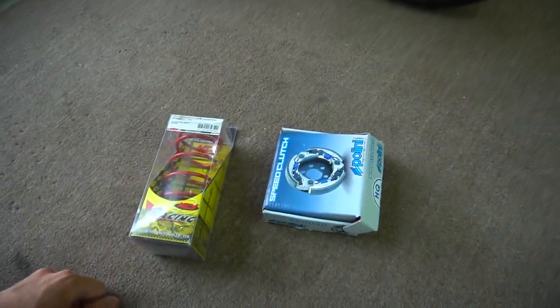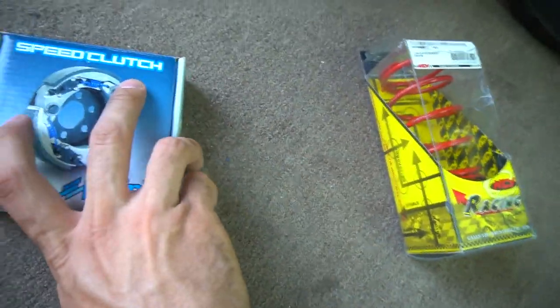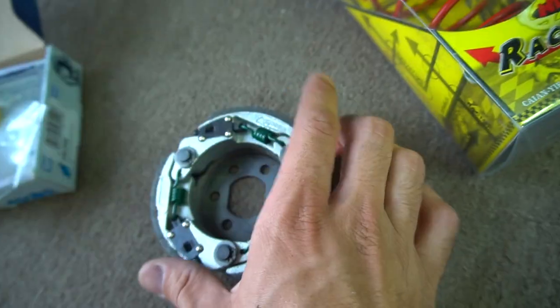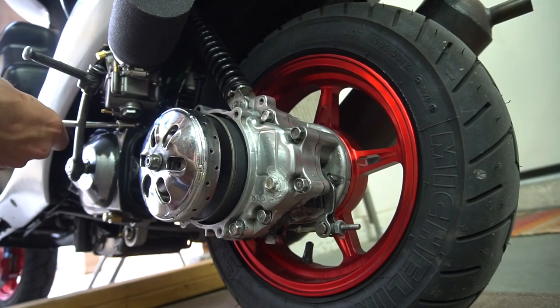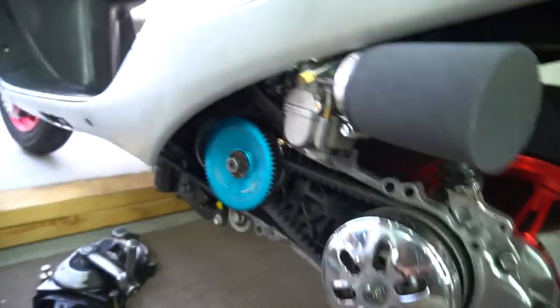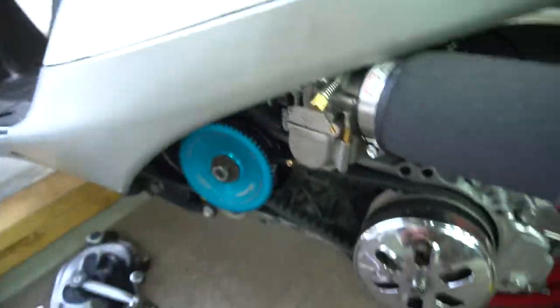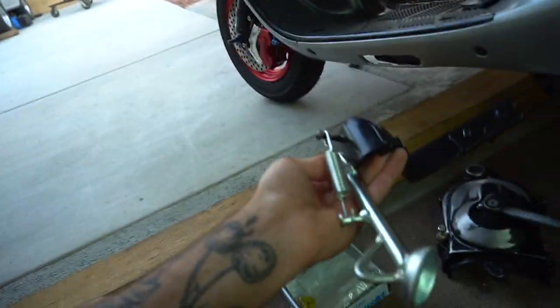Now on to the stroker piece with the new Polini adjustable clutch. We got the 2000 center spring and the Polini adjustable clutch. I'll go ahead and throw this clutch in now along with new center springs - I think my center spring is definitely dead by now. I'm also probably going to down-jet the carb because I was having issues last time. I had to take the center stand off because of the big exhaust pipe, and it rattles since it doesn't have a rubber mount like some types do.